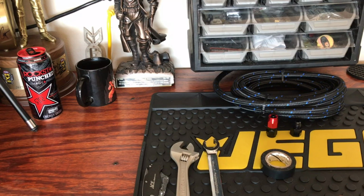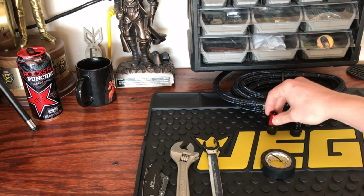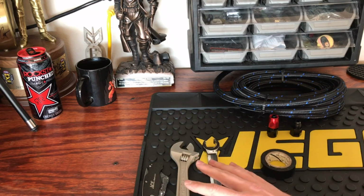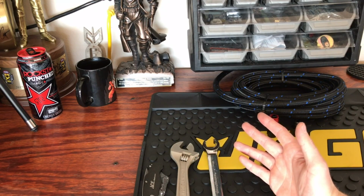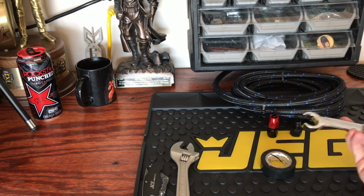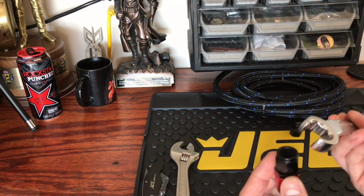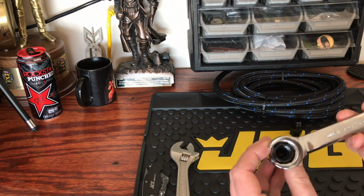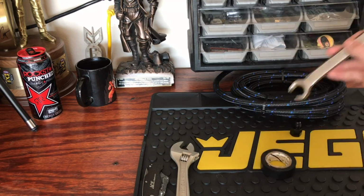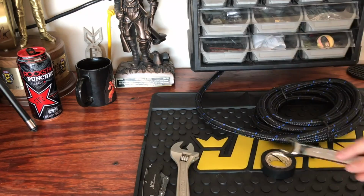So you got your fuel line, you got your AN fittings, but you don't want to spend a whole lot of money on the tools that are actually made to install these without really damaging them. Now, this is possible to do without damaging them with your normal, ordinary house tools, I guess you would call it. If you have flare nut wrenches, both metric and SAE, you might be able to use those. You just have to find the right flare nut wrench for the specific AN fitting, and that will work because it'll fit over the fuel line in order to tighten it down.